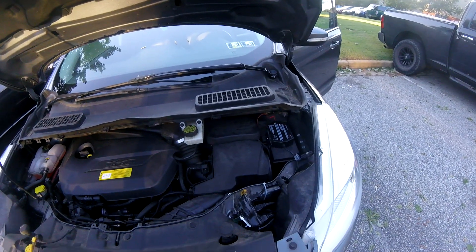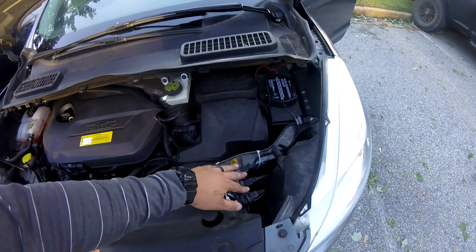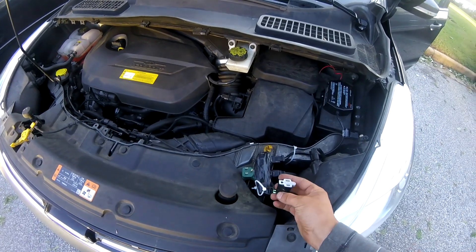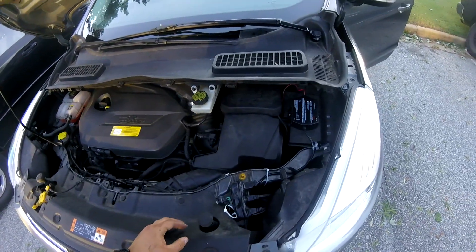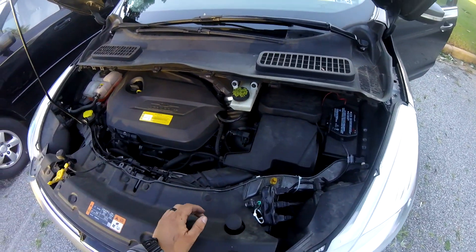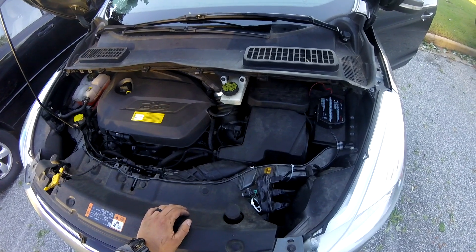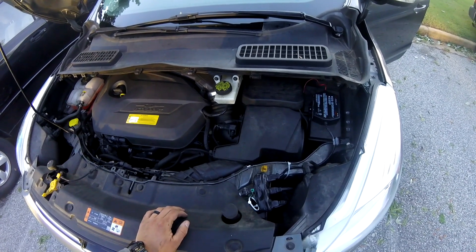Here's the final product. I'm not very happy with how it looks — it didn't come together as nicely as it did on my truck — but overall it should be a pretty watertight system. Here's that little cap I was talking about. It should be functional and it'll be hidden under the hood anyway. To recap: I have the battery maintainer, the battery warming pad under the battery, and the oil pan heater, all hooked into one system. All I have to do is plug in one extension cord and it should be enough to keep the vehicle starting in Alaska. Let me know if you have any questions, and thanks for watching.